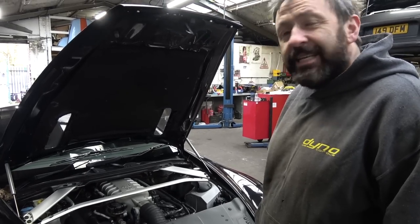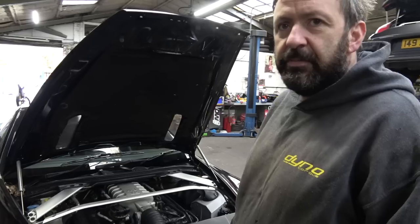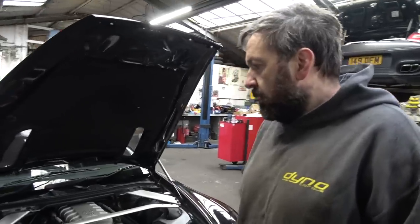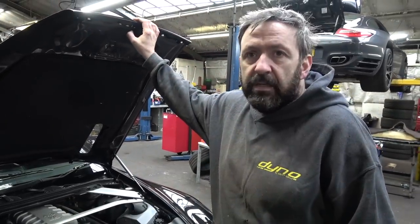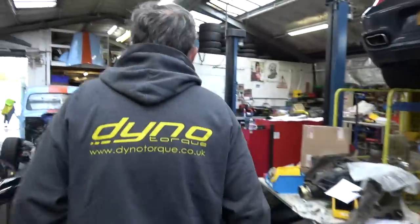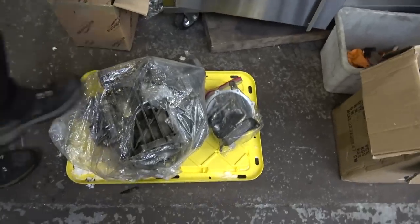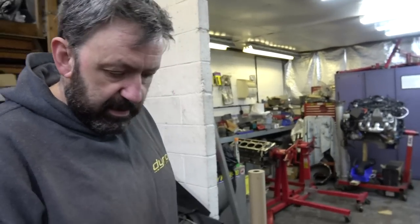So how much power is this? They're supposed to be 380 horsepower. When you're used to 600-plus and 600 foot-pounds of torque, it probably makes 300 foot-pounds of torque. So for the gearbox, I've decided to use a Z06 Corvette setup. That's a Z06 diff — it bolts right to the back of the car — very, very strong. And if I do break it, you can get replacements for two or three thousand dollars.